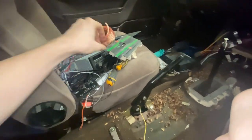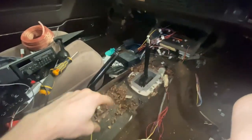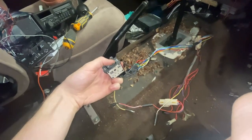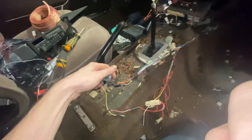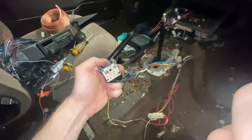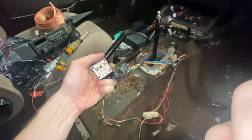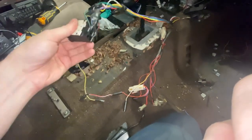I'm removing the centre console because I'm installing a new head unit, as I mentioned earlier. It has a four-channel amplifier in it, which means I don't have to deal with this little fader control that Rover put in the middle. I'm guessing it's only there because the original head unit would have been a two-channel amplifier, and to get fade control between front and rear they ran it through this little voltage splitter. So when it's in the middle, both speakers get full voltage, and when you run it to one end, the front or rear goes through a resistor to dump some of the voltage.